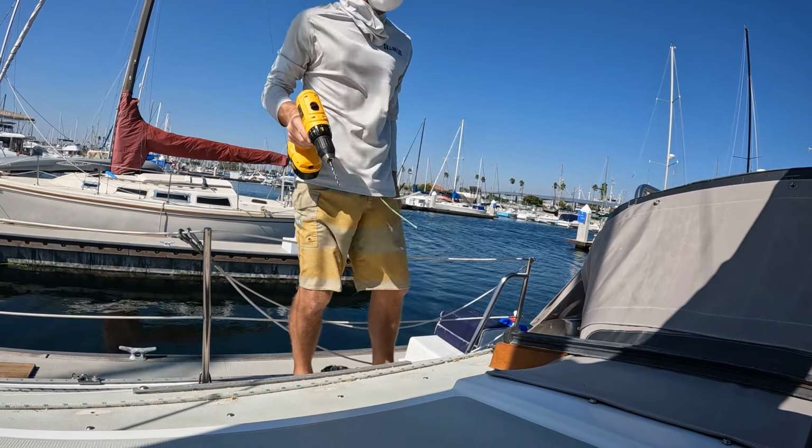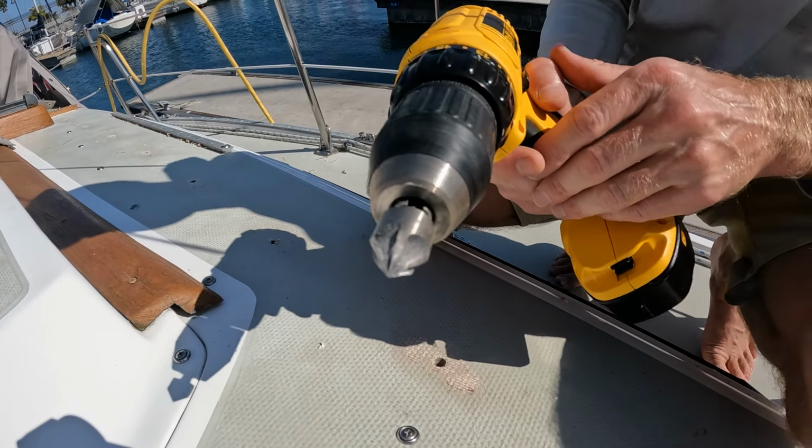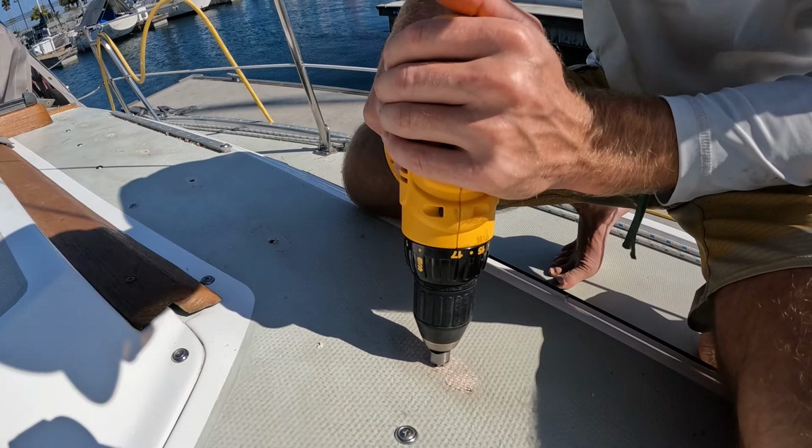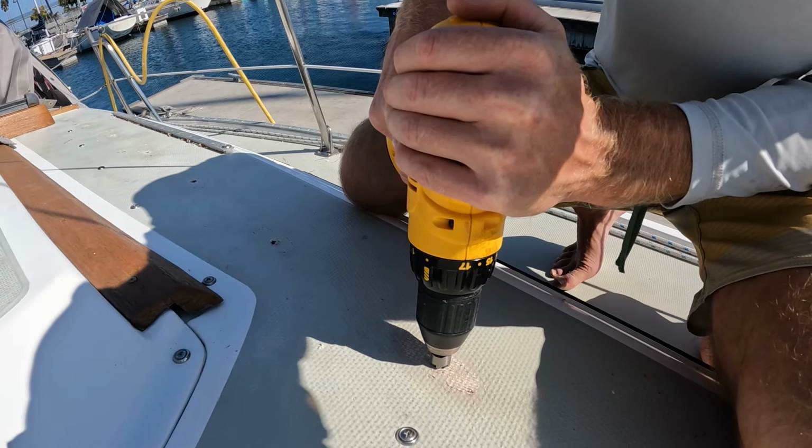After drilling all of the through holes one size larger than the original hole sizes, we attach the countersink bit and countersink all the holes. Doing this ensures spider cracks will not form in the paint, and it will also leave a nice divot for the silicone sealant to settle into.